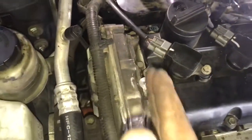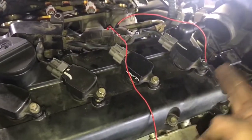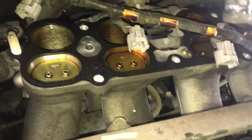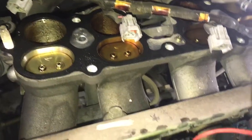Because this is a four-cylinder and this is the front of the engine, we have cylinders one, two, three, and four from front to back. What we're going to do is go to the injector that's bad, so we're going to take off these alligator clips and put them on number two.